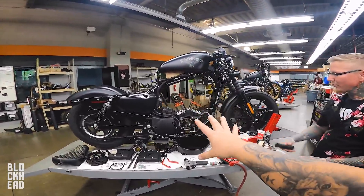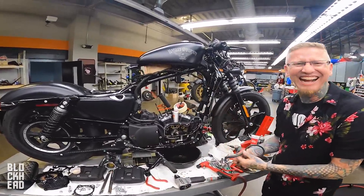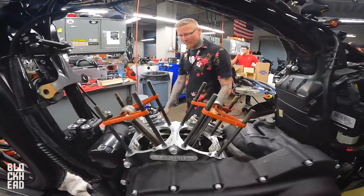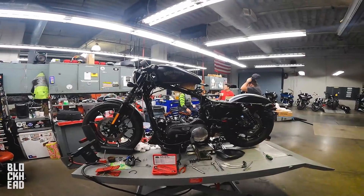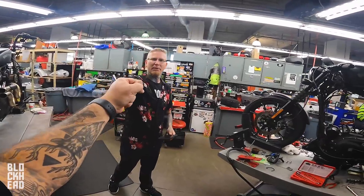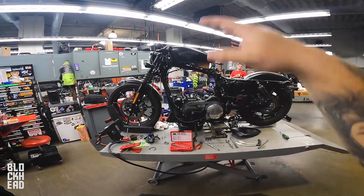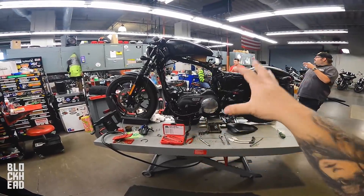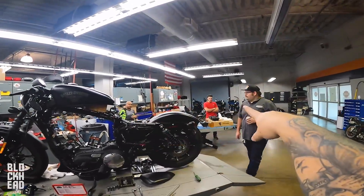So we've reached a stopping point with the Sportster — no longer Iron 883 — giveaway. That is episode one of the S&S 1200 hooligan kit on the Iron 883 up here at Seminole Harley-Davidson with Chris Sick Wideglide. We'll continue in episode two building it back up. We've basically taken it down: cams out, cylinders, pistons, heads, all that stuff off. Next up we'll reassemble with the new stuff from the kit, using stock heads and stock push rods, putting in the new cams. Big thanks to BaggerBro, Greg, and Javi for coming along.